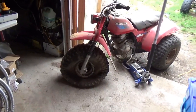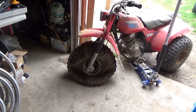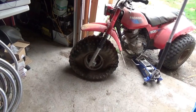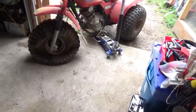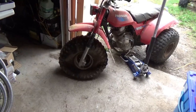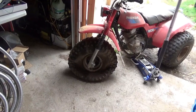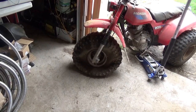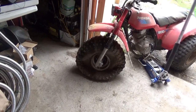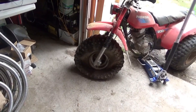Theoretically this tire should only need 8 ounces, but I'm thinking it's gonna be more like 16, so it'll probably take a major part of that container. From a price point of view between the tube and the slime, it's not a crazy outstanding difference. From a work point of view, if you don't have to break the bead it's a lot easier. I'm not sure what's going on with that rim and bead - my anticipation is it's pretty rusty and nasty.